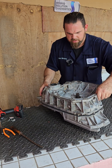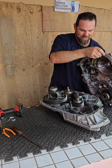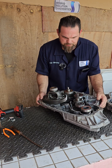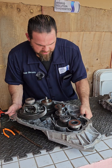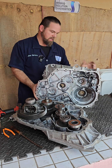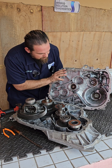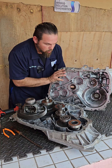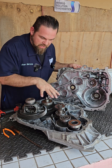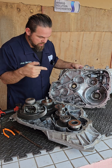She's coming out — there it is! A couple of gears came out. We've successfully opened the Nissan e-Power transaxle. This side is the internal combustion engine side. Over here is the input shaft that goes to the internal combustion engine. I have to take out the differential to access it, and the shaft that goes to Motor Generator Number One is located right here.